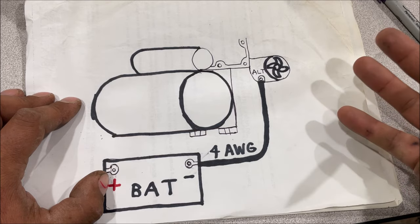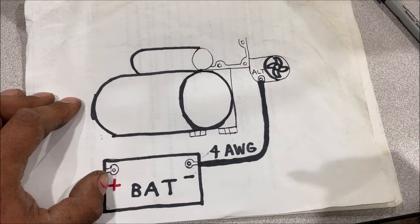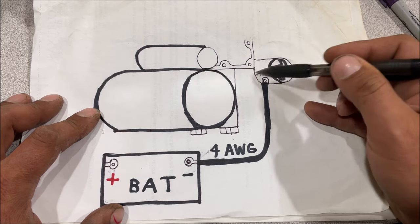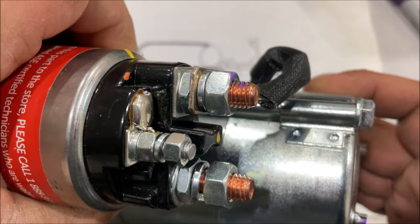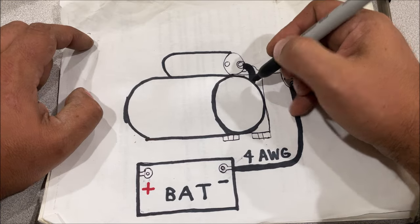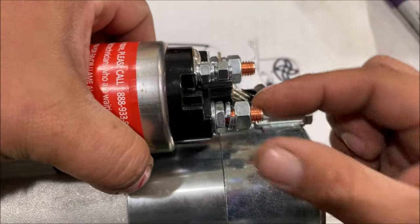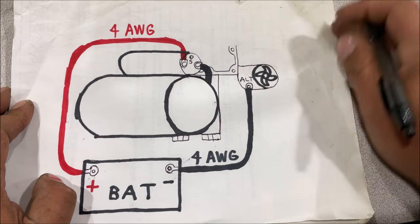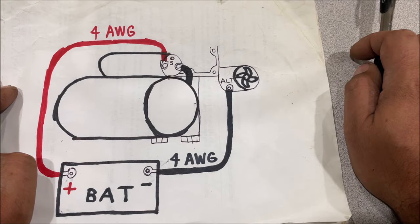There's no wire grounding the starter — study your wire diagrams. If you're wiring a project from scratch, run your ground to the alternator bracket, valve cover, or engine block. We've got two lugs: one goes straight to the starter, the other goes straight back to your battery. Then we have our small terminal S.